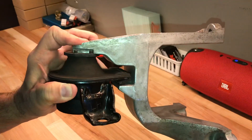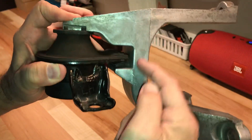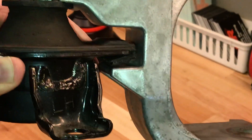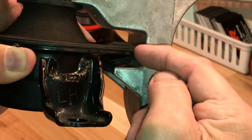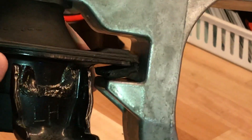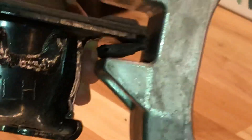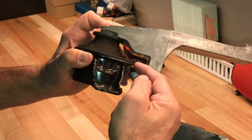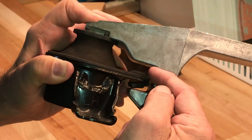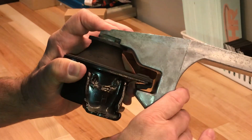I'm not going to install that right now, but what you're seeing here is a rotation limiter tab inside the window. What will happen over time is that as the motor mount area softens and collapses, this tab will rise up in the window. When you feel vibration and rattling in the dash, the car feels noisy in the cabin, and the drivetrain feels a little sloppy — that's generally when this tab is riding right up at the top, hits that limiter, and the whole dash starts to rattle.